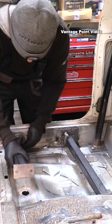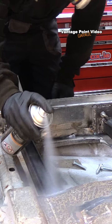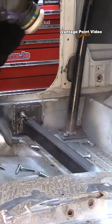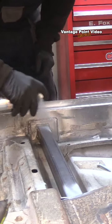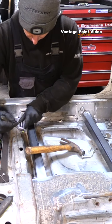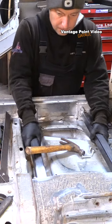I'm not going to fit them permanently now because I want to be able to spray them and underneath them properly when doing the body of the car. So I put on some weld-through primer that I still had to hand, just to stop any flash rusting. I came back the next day and bolted them in a little bit just for the satisfaction of seeing them sitting there.